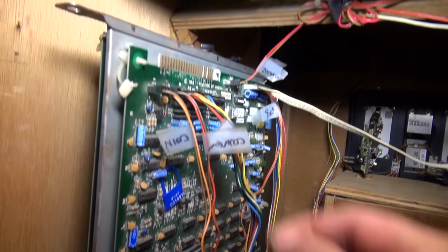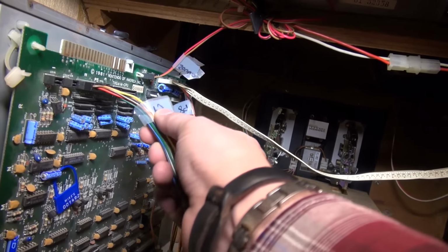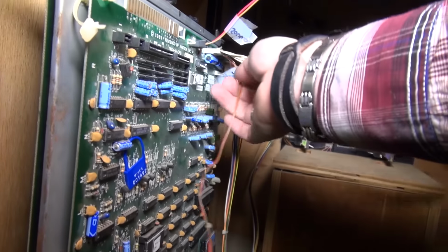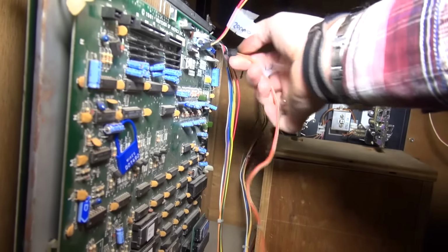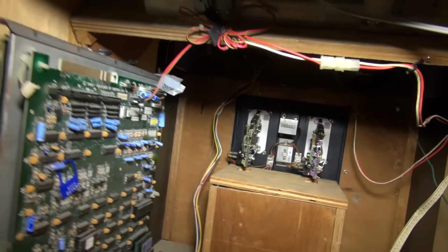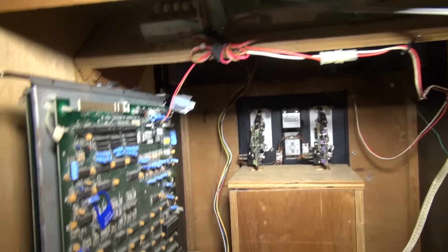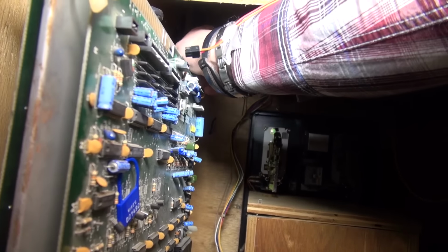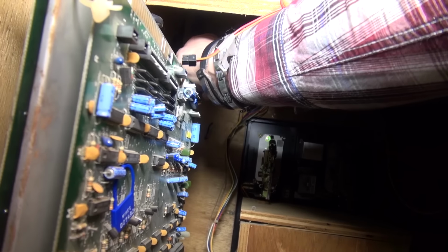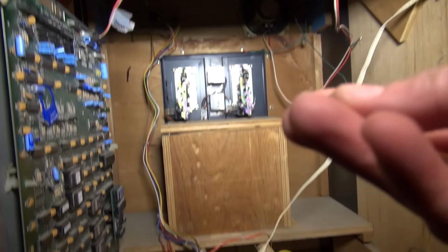So anyway, let's remove all the little connectors here. This one's for coin. This one is for counter. I labeled these a long time ago. This is P5, and then this is video. And that one, and that one, and that one, so that's it. There's another plug on the other side for power to the back board. I do have some thumb screws in the back here. I think my game was missing the L bracket or only had one of them, I don't remember, but I had to make my own thumb screw situation here. I don't recall to be honest.